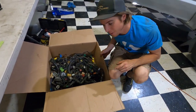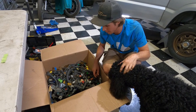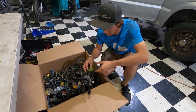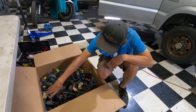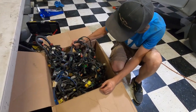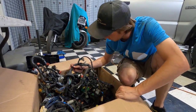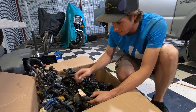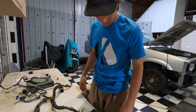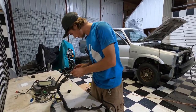From my inventory I have lots of wiring harnesses. So I'm going to find a harness out of here and sacrifice it, cut all of the plugs off of it to utilize my new harness. I have five harnesses in here, various ones. This is from a convertible. So hopefully I can find one with high impedance fuel injectors in here - we don't need none of that low impedance injector stuff. This one says '88 only, no injector resistor.' If it doesn't have a fuel injector resistor, it's running high impedance fuel injectors, which would make a cleaner wire harness and not have to run a resistor in here. But these plugs are broken.